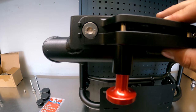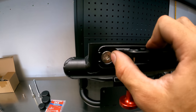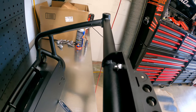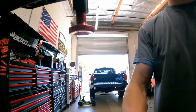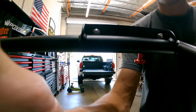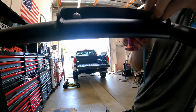I like to keep it down here rather than up high — it makes it a little easier installing it off the truck too, because the bolts will self-align it if you just push down evenly across the whole thing. Once you get the first bolt snug, switch to a wrench to tighten the rest because it's very tight in that location. You can stick a wrench down there and tighten it with an Allen wrench in the front.